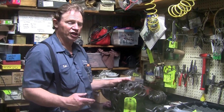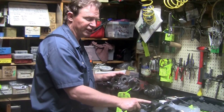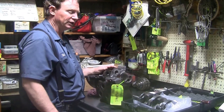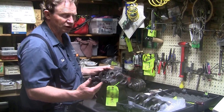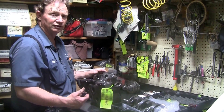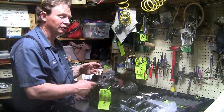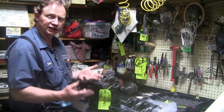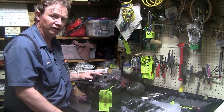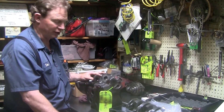The only situation I know where it doesn't work well is in my Bonneville application. This crank was tested in my Bonneville engine and the crossover point on that is up over 6,000 RPM, but I still lose a little bit of horsepower right at the very top. In Bonneville where you have no shifts, I need all top-end speed. For a track — someone racing around curves or a rally where your engine is constantly up and down — I would think the 50-50 would be ideal. Driving it in my '61 is pretty phenomenal, the difference between what it was and how it is now with a hybrid crank.